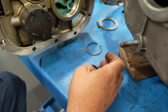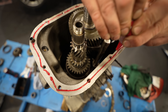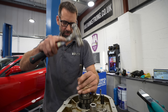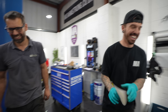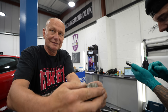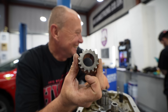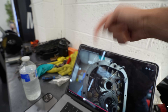Things are looking promising. Dad removes the original gearbox filter and it's absolutely caked with metal debris — which tells us something went seriously wrong, even if we don't know the exact reason the gearbox was stripped. Everything that's gone back into the box now looks in good condition. Dave adds the final certified touches to close everything up.